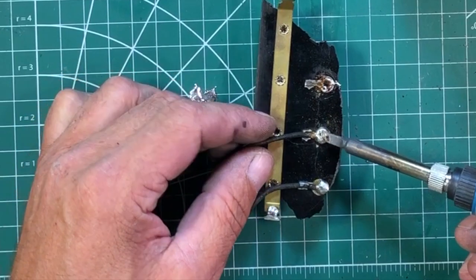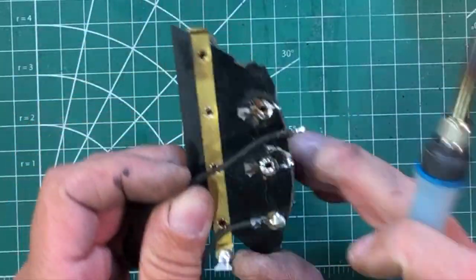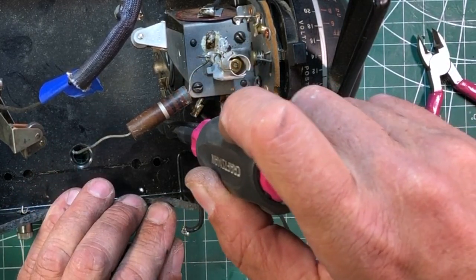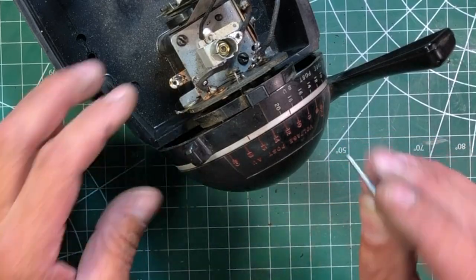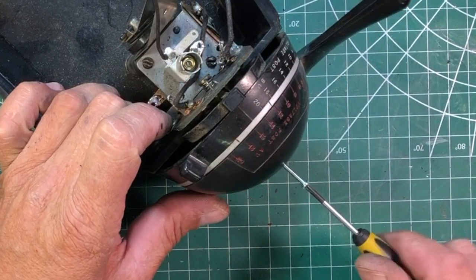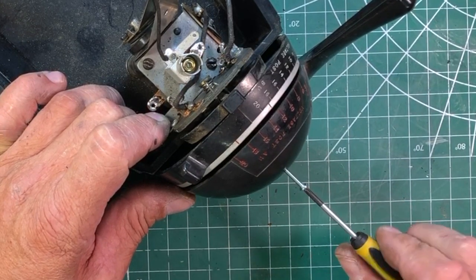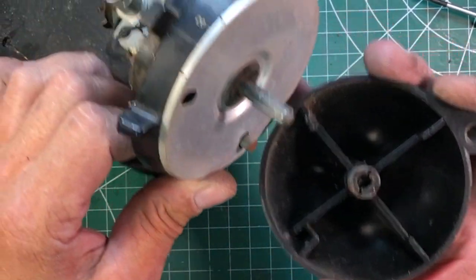Open up the strain relief right here — I'm using side cutters — and get your soldering iron out because it puts out a lot of heat really fast. Get the solder nice and toasty, and that wire just comes off. Now that I've got all the wires disconnected from this old circuit breaker, we'll just pop it out. Here's why you need that 4-40 by 1 machine bolt: there's a little tiny hole in the bottom right in the center. You thread the bolt in and screw it in, and it acts as a puller to pull these handles off the shaft.